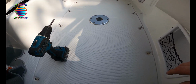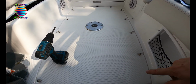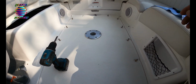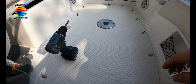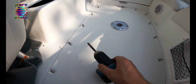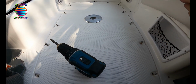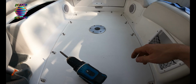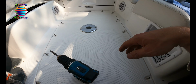Now, you definitely do not wanna tighten these bolts and crank them down and finally torque them with a drill or anything. You want to do it by hand. I just use a little ratcheting wrench so I can feel each one. I do use my drill, and I set my drill in like the super low setting on the clutch, to where I'm just using them to speed them down. And then after that, I just go around and I just slightly hand tighten them, and that's good. There's more than enough screws here and bolts to keep everything tight. So here we go.